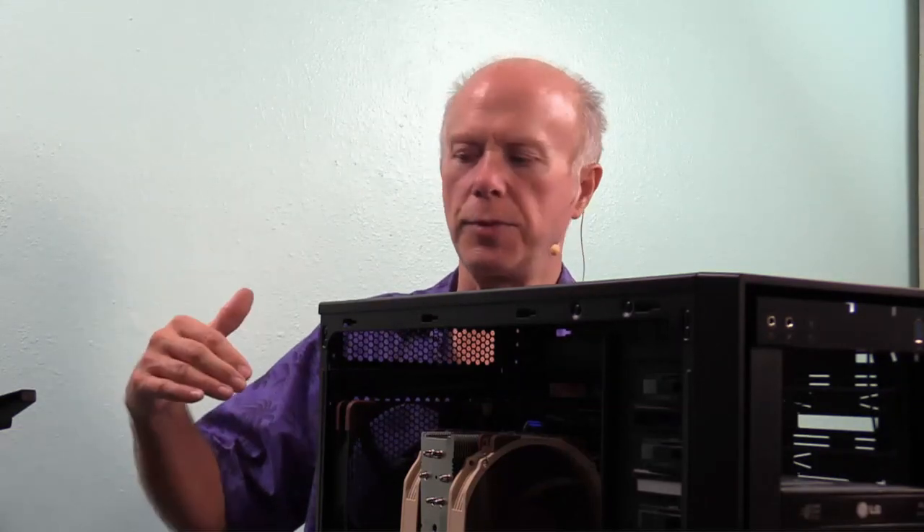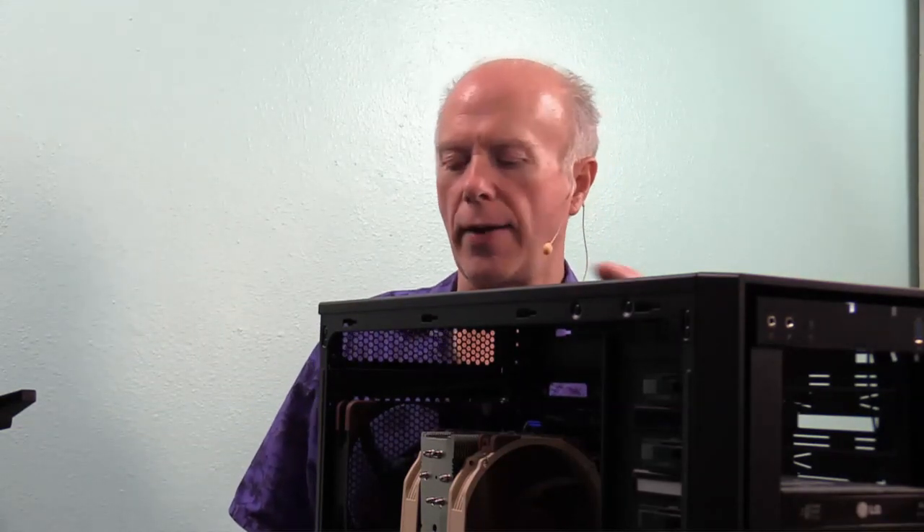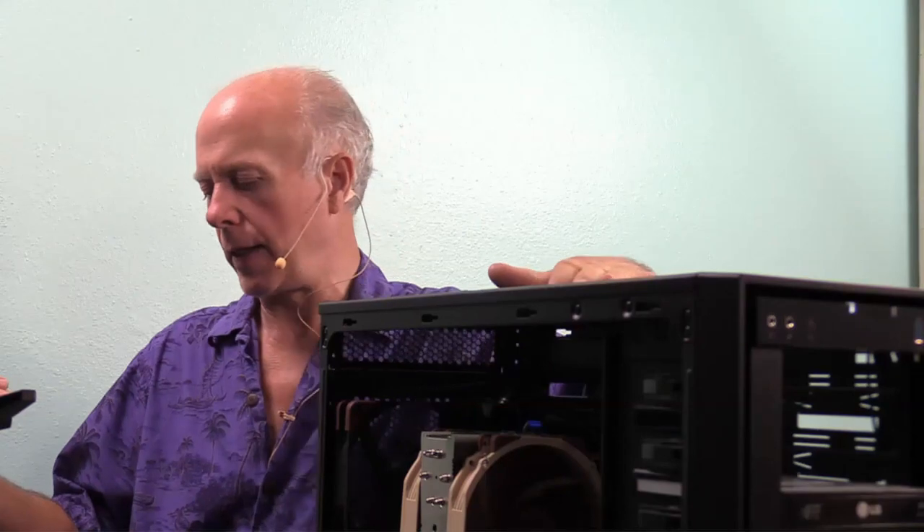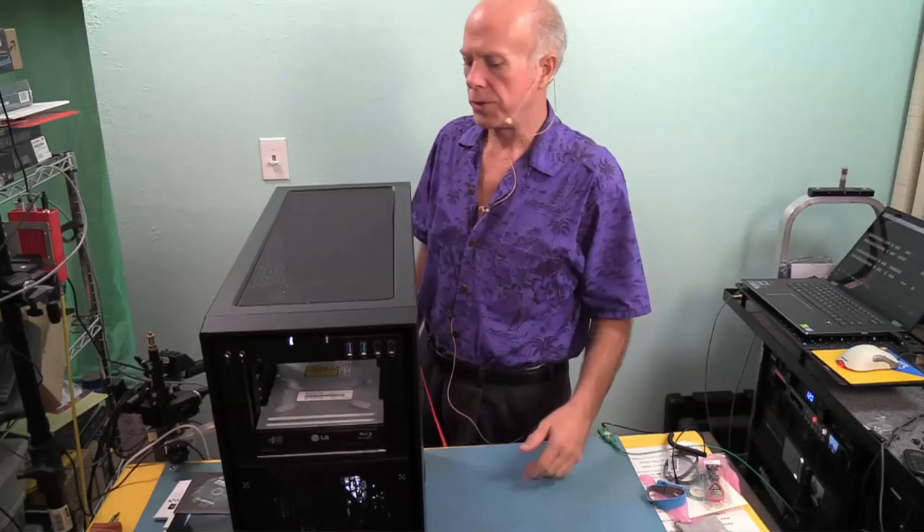With the wiring harness we drop a USB 2 port but put USB-C up front. With the drive bay device we gain USB-C but keep two USB 2 ports. We're going to probably end up with a single lane IO card so we give all our ports access to the motherboard resources. I don't like stuff on the front of a case that's not plugged in or functional - that's just annoying. But I want to go through and check all of this because it all matters. As we build this foundation and eventually get to Thunderbolt 3, I want to make sure it's a successful install. At this point we need to reboot - but instead of rebooting, I want to shut the machine down and get that second hard drive in there so we can start putting our data and stuff over.